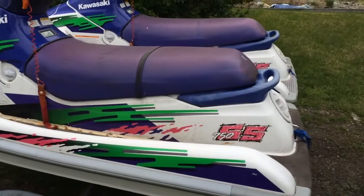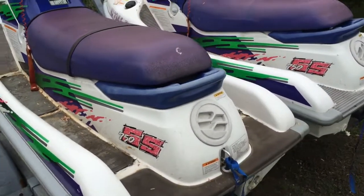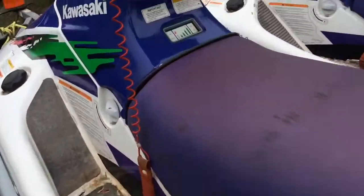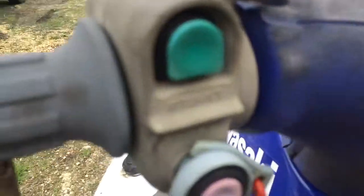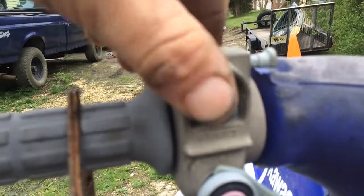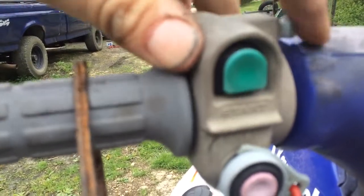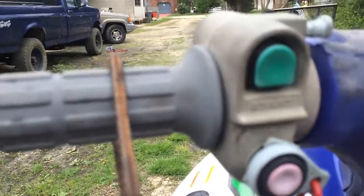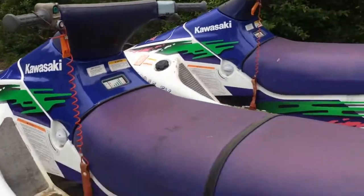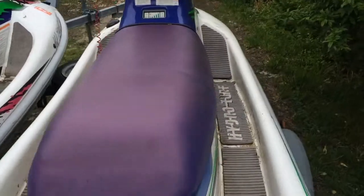This one, I had to put a little bit of electronics back together — I only had it finger tight. What the problem with this one was, the starter — it was this little button right here. When you pull that out, I can push the starter all the way in and get it to go. But when you do this, you can't start it. I guess he forgot about that and thought the starter was locked up. It wasn't locked up. It was just that. He started tearing apart the whole thing, but at least I got a carb kit out of that.